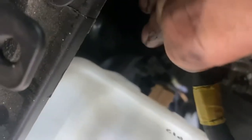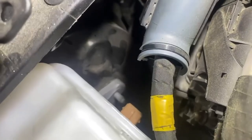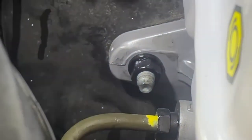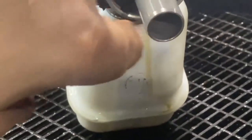This side is going to be tricky because it was a pain getting it out. Leave the connector unplugged for right now to give you a little more space. Get your washer on and then your nut on that stud right there. There is a plunger in the booster - you want to make sure that you fit that inside of the shaft on your master cylinder.